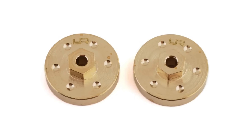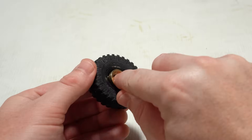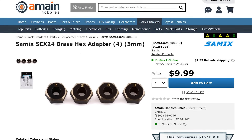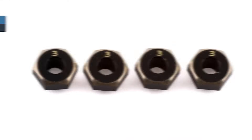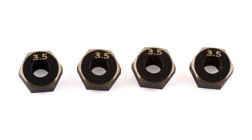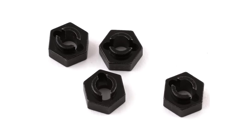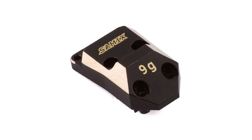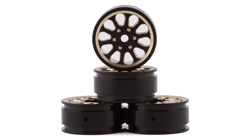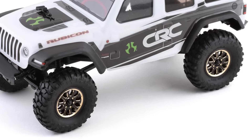These Ya Racing hubs replace the plastic hex and they sit behind and kind of inside the wheel, adding over six grams each or just under one ounce for the set of four. Another metal hex option is from Samix, who offers SCX24 brass items in black colored coating. The hexes marked 3 are the stock width, and those marked 3.5 add an extra half millimeter per side or one millimeter total. SSD also makes blacked out brass hexes in the stock width. Another cool blacked out brass piece is the Samix brass differential covers, which add nine grams each and fit on the front or rear axle.